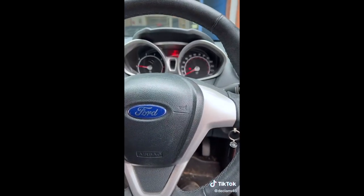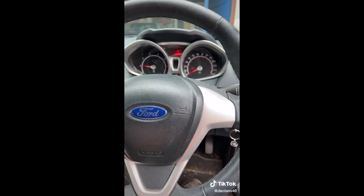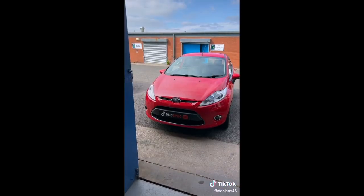So that's it started and it's quiet as a mouse now. I'm going to give it five minutes on idle outside - that'll heat the exhaust paste up, and then when it cools down it'll slowly dry out nice and hard and we'll get no leaks.